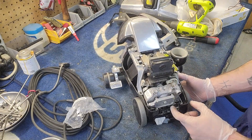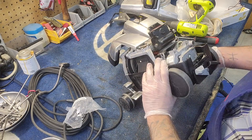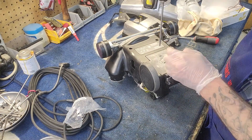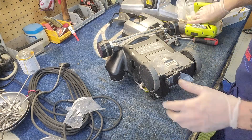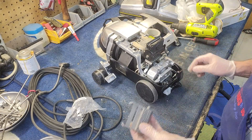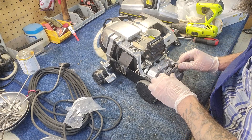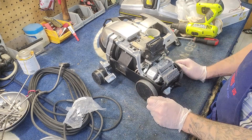My fork is in, my belt is on, and my switch actuator is down here and loose so I can hook up my plastic switch. I'm going to put the three screws in — these are the three long silver screws, one in front, one in back, and the final one. Now I'm going to put the plastic switch actuator back on. I'm going to grab this little metal rod down here and hook it in, then go down so the two clips up top snap in. That actuates well now.